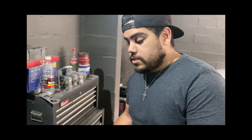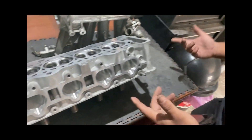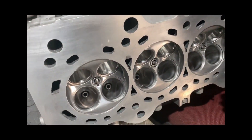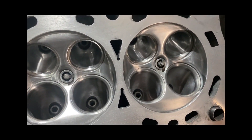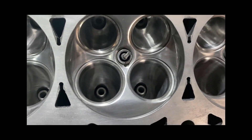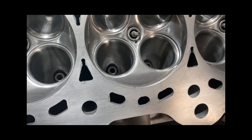I used to do tumble ports in it. Floyd Performance was the only back-to-back test we got, but his car spins on the dyno — he says the car feels better. The exhausts are more polished than the intake. The intake I finish at 200 grit, exhaust at 800 grit, then polished. Basically, the valves are opened up 2mm side to side and up/down — so 4mm total seat-wise.